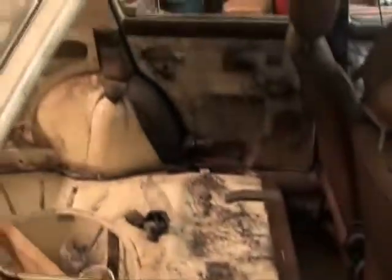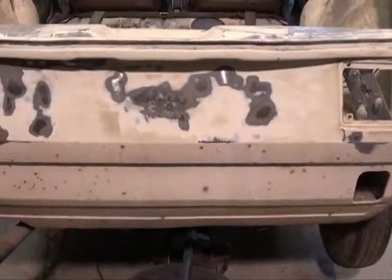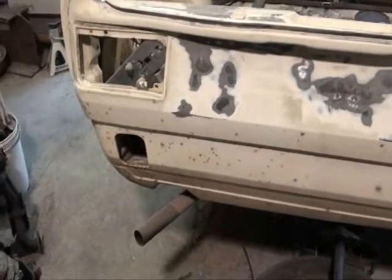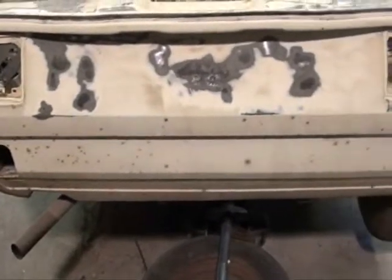You can see it's pretty well stripped down. Took the back seat out, get it out of the way and get that rear mat out. Basically what I'm doing is taking all the rust spots down to bare metal and then I'm going to treat them all, hit all the spots with some sealer, and then the whole car with some 2K primer — I think it's polyester that I use. You'll see all these little rust specks everywhere. You wipe the rust off and it's a tiny speck, but when you sand down through the paint and primer, the rust underneath is as large or even larger sometimes.